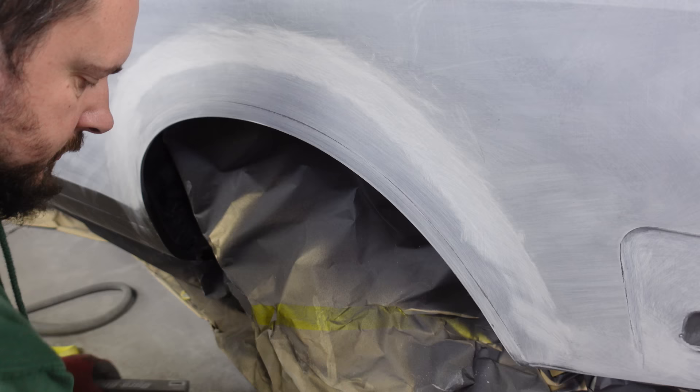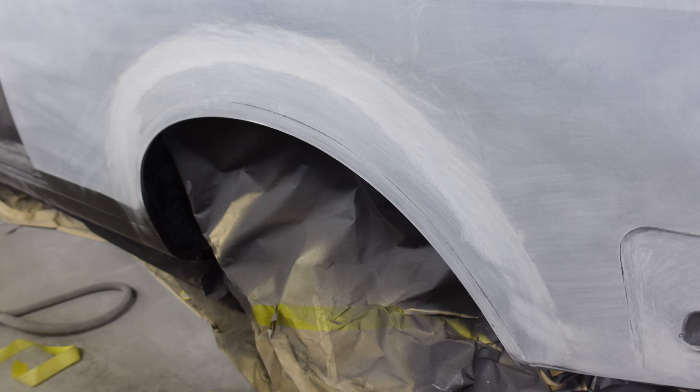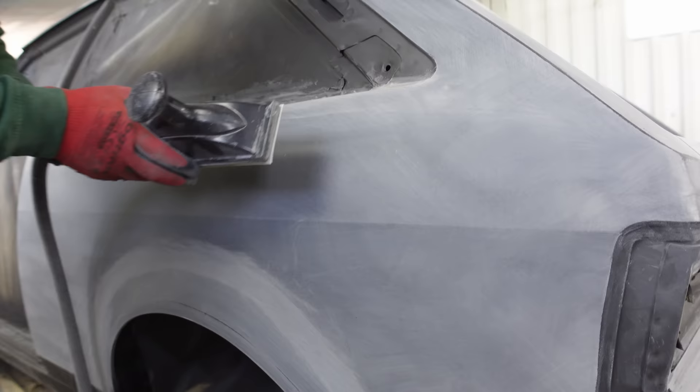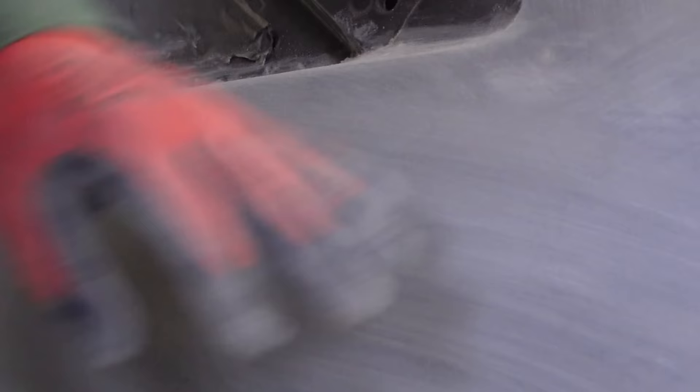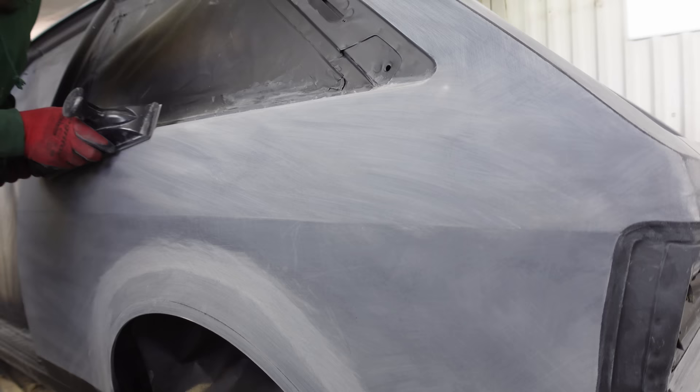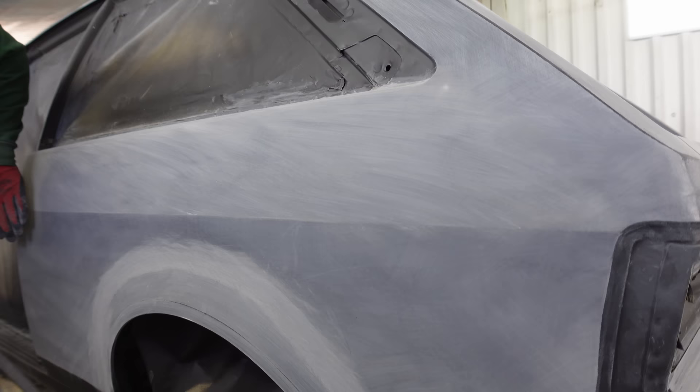That's lovely. We're going to move on to this little round Dura block - we're using them because they curve and this is a curvy part of the car. Just run it through the radius, rocking backwards and forwards, making sure we've got it nice and flat. Now we're going to do this edge using this long thin squarey Dura block - just hold it flat and go from one side to the other, keeping an eye on it. See how it's patchy in areas? That's telling us we need to keep on flatting. Always be careful of your swage line - try not to work at it too much in one place because it will move very easily.